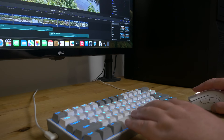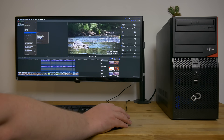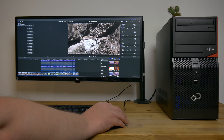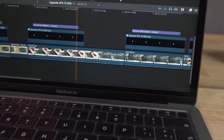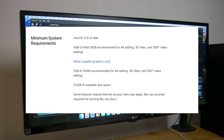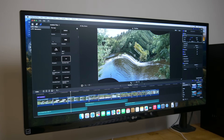The main reason for doing these upgrades was to improve 4K video editing performance, and this is where this hackintosh really excelled. Editing 4K video was now silky smooth with no dropped frames during playback, and skimming was perfectly smooth too without the stuttering I'd seen when using the integrated graphics. Exports were very fast as well, using the hardware H.264 and HEVC encoders on the RX 460 — definitely faster than any Intel Mac I've used. Apple recommends at least 1 gigabyte of VRAM for editing 4K video in Final Cut Pro, so the 4 gigabytes of dedicated GDDR5 on this card really helps a lot.